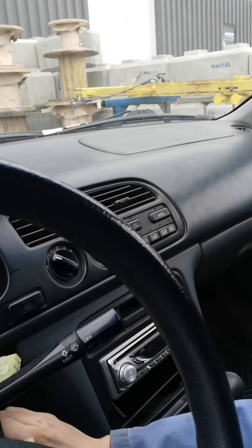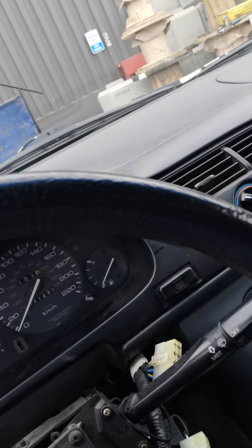Can't go wrong — that is a huge savings. Car's back up and running again. You can test those switches at the pick and pull the same way I showed you in the previous video, except what you're going to want to do is disassemble the switch first from the ignition lock cylinder, because obviously there's no keys at the pick and pull. Disassemble that, get the switch out, keep it plugged into the main harness, and hook up your own meter.